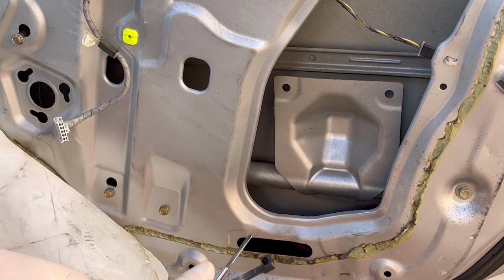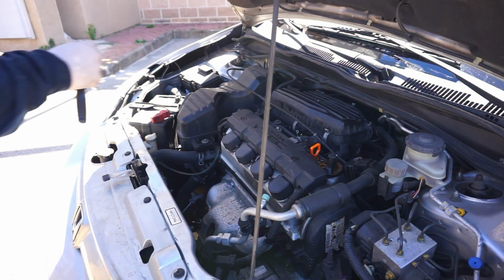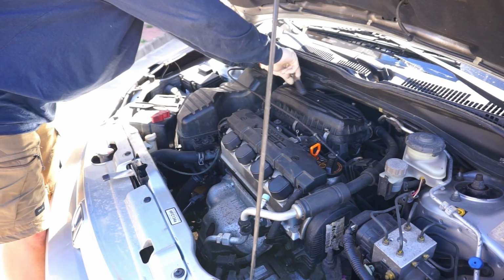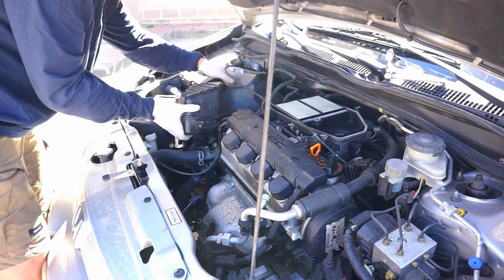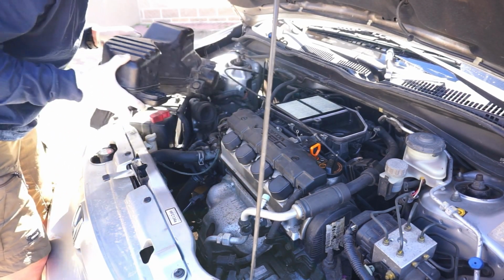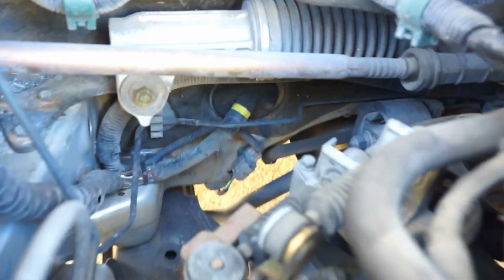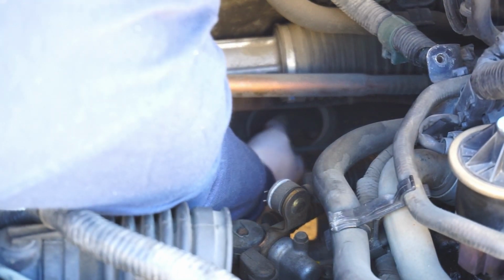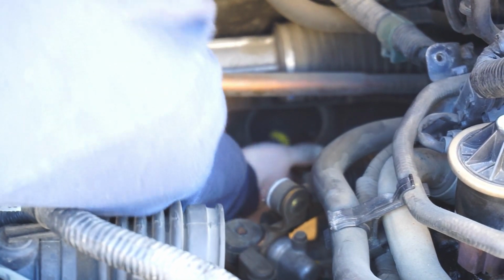Now let's face the unavoidable and figure out the wiring for the battery. For this, we will need to run some wires from the battery to the interior of the vehicle. And that means going through the firewall. The firewall is the metal wall that separates the engine compartment from the interior. And usually the firewall already has some factory-made holes for things like the engine harness, so for now, no drilling is required.